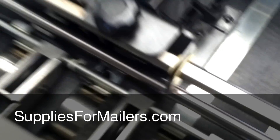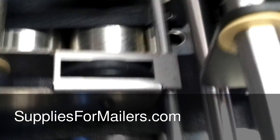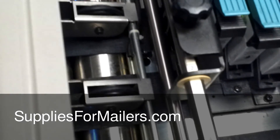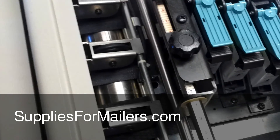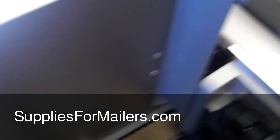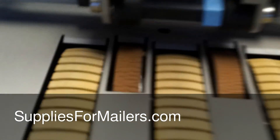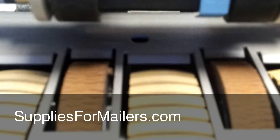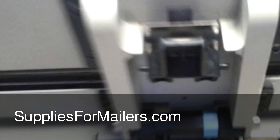Cleaning the 30K: your paper sensor is right down in there — here's the top half, and the bottom half is down in that hole. Just take some compressed air — preferably something without any dust or moisture in it. We do sell the Clean Jet and also our own branded air that's safe to use on electrical sensors and won't blow dust or moisture into the sensor. The feeder has its own sensor which is a little harder to get to. You can see the hole down in there — that's the bottom portion, and that's where you have to spray some air.